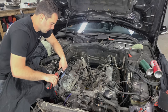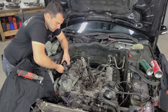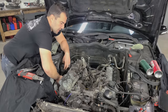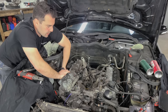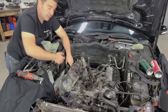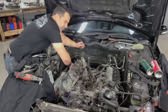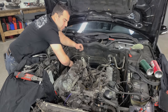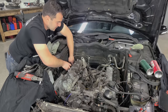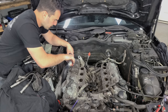At this point we're going to remove the ignition coils — get our T30s out of here. I've never done spark plugs on this car, so I'm curious what's in here. This car was already modified with a larger crank pulley for more boost and mid-length headers, so I'm hoping they ran one step colder plugs. Either way, I'm going to replace the plugs. With the coils out of the way, we can remove the valve covers.